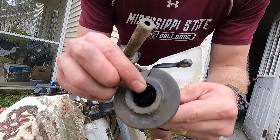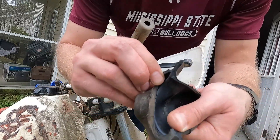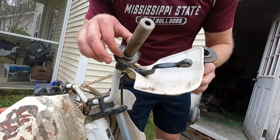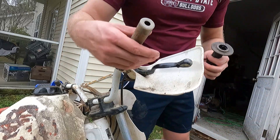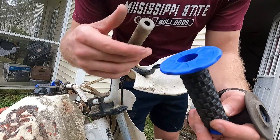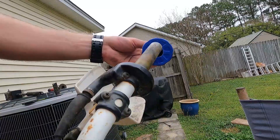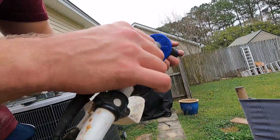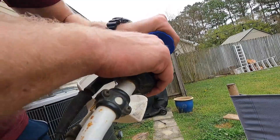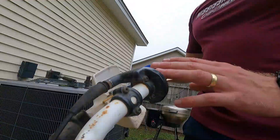Now I've got this one off. You can see the Honda grips actually had a lip in there, which was meant to hold onto a lip on the bar to keep them from sliding off. Before you buy these new grips, notice they do not have that lip. I'm going to try to fit it on anyway and see how it feels and looks. I catch it on the bottom and kind of work it around to fit it on.